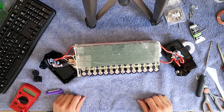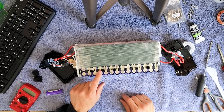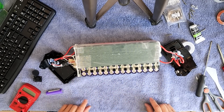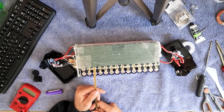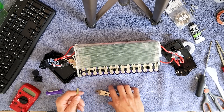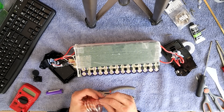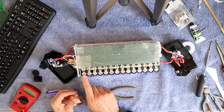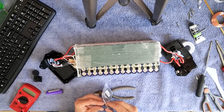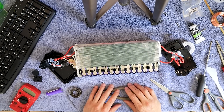These have the strips going all the way over to the end one, so we don't need to cut those strips — that's quite convenient. If you just have these brass strips, you could use nippers to cut a piece and lay it in there. Even if you had some thin copper wire like 18 gauge wire, you could use that as long as it doesn't stick up too high. I've got nickel strip, so I'm going to use that — I'm going to cut just a small piece, just enough to go in between. Alright, let's get soldering.